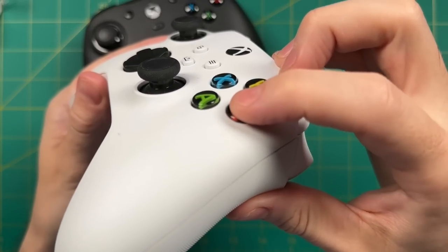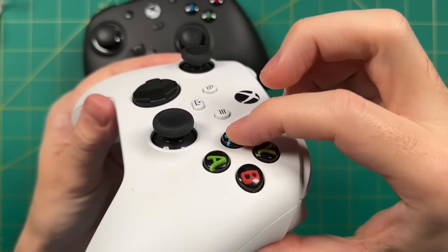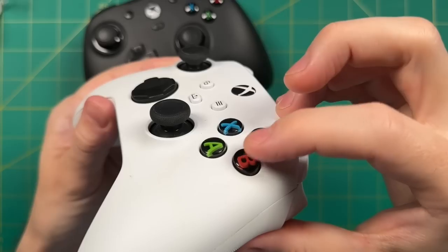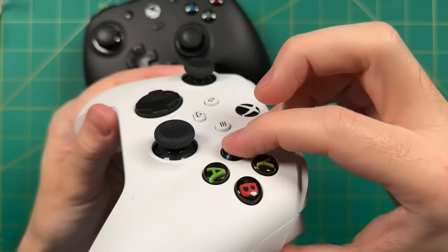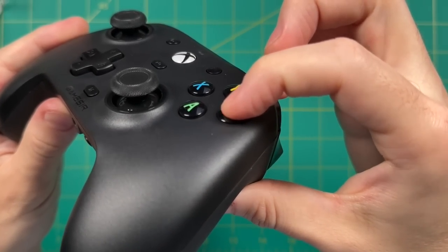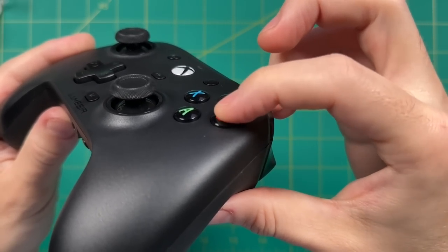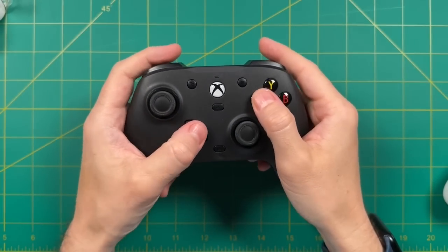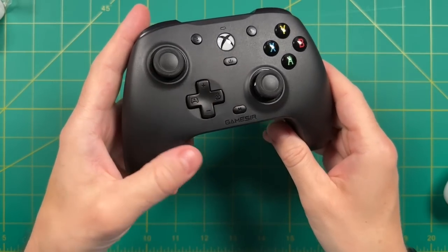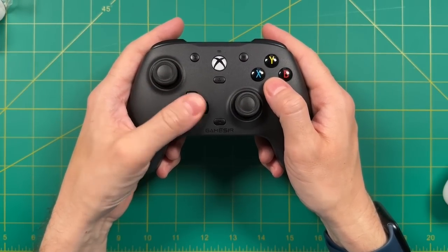Comparing to PlayStation or Xbox controllers: those have rubber membrane connections, making them feel a little soft and mushy. Also, those buttons are a bit loose in their housing — you can move them around. The original Xbox controller just feels a little looser and softer. I don't mind rubber membrane buttons at all, but I've come to really favor these micro leaf switches. Another thing that surprised me: the face buttons are super tight in the housing — when trying to move them, there's no play at all. Walking away from this review, this is actually the controller I want to use most. Overall on design, there's really not much I would change.